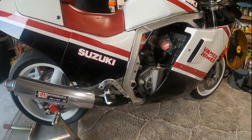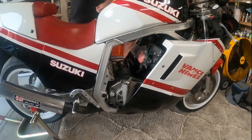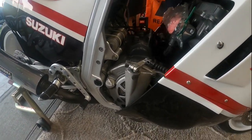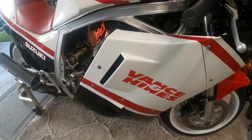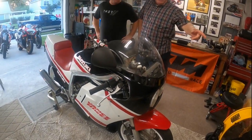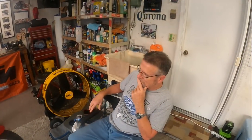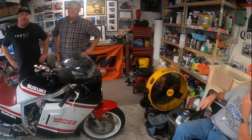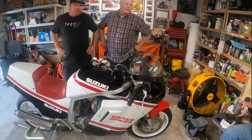This bike's got a lot of little unique stuff. We got a Fox race shock on it, like you said, 36 flat side carbs. You got a dry clutch setup, which was really neat for these, '88 front end, and just a lot of little trick bits that you just don't see no more. And Kyle Spradlin can tell you everything on the motor that we had done to it. As far as I remember, head ported, oversized intake valves, Cosworth pistons, Carrillo rods, quite a bit of stuff done. Very good motor. Yeah, higher compression, milled the heads and the cylinders.